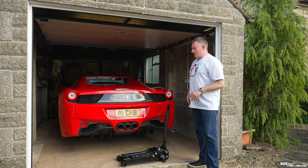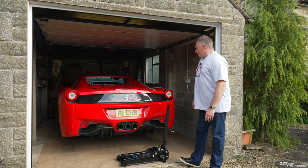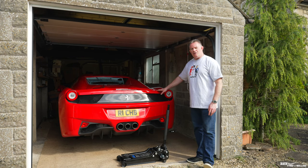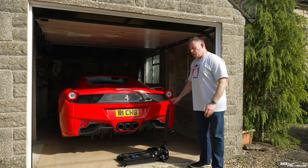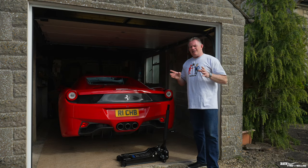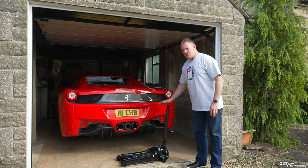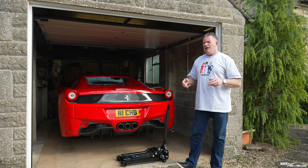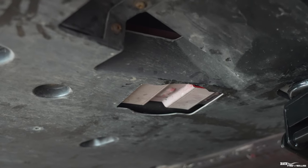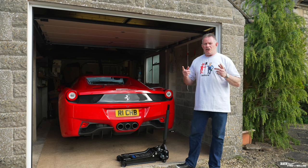Repeat the same process for all four corners. With the car on axle stands for a few days while the wheels are being refurbished, it's a great opportunity to have a good look around the wheel arches, clean the calipers, and oil any bare studs showing inside the wheel compartment using GT85. Ferrari aren't known for using stainless steel bolts on these cars — they used standard steel bolts, and steel rusts. There's very little information online about specifically how to jack up and put a 458 on axle stands — I had to research it all myself.